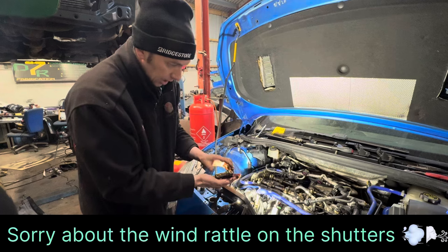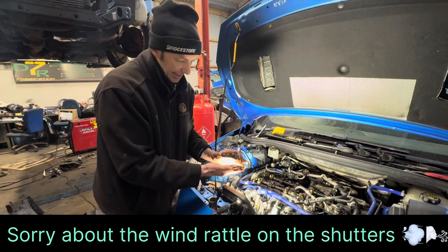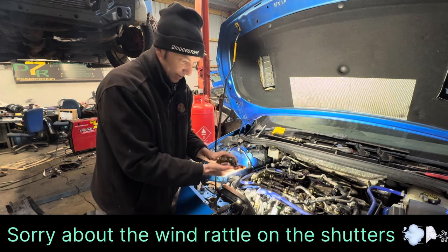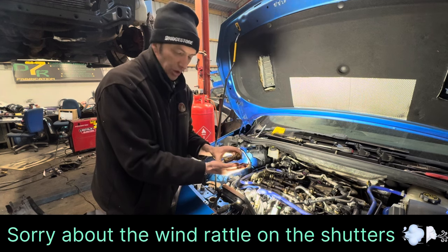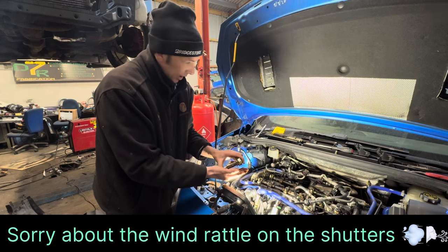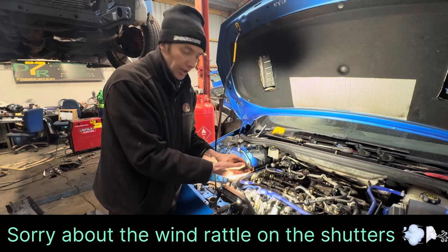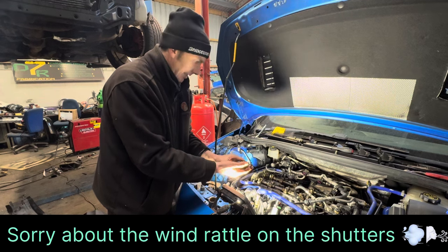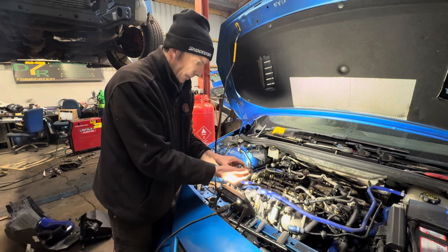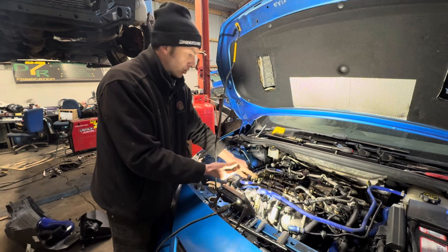So that would have caused it to lose tension and perhaps jump some teeth? Yes, potentially. As I say, I've done quite a few timing chains on these now. I even bought a non-runner myself, and I had to go through the same process just to get it to eventually run. But you'd normally find the guides have either broken or the tensioner has done its course and it's failed. So what damage would that cause if it failed, like it is now? As it stands now, we're potentially looking at bent valves, even just the slightest bit, if it's managed to jump at a high enough speed. It's hard to establish how far it is out, but we try to get the gold links as close as we can, and we're averaging about three to four teeth at maximum where we're out, and it looks more so on the intake.